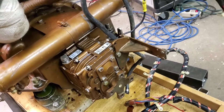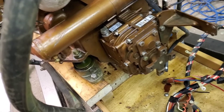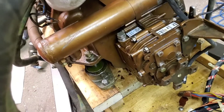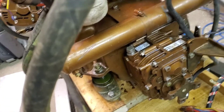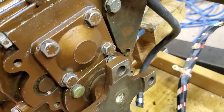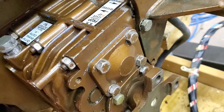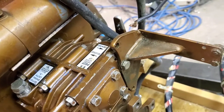Alright, I went ahead and put the transmission back together. I finally got all the parts, so I put everything back together again. Used blue RTV rather than make gaskets — figured they probably didn't have RTV when they put this together the first time. You do need to check the fit though. There are some rings on here inside that hold the thrust bearings. Very important when you remove those plates that you pay attention to which rings are on which side. Also, if you replace with RTV, that spacing may change — so check that fit.